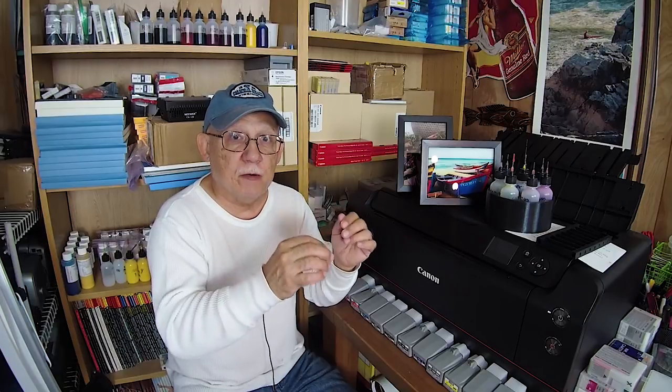It's beginning to make sense why you should actually print during that idle period. The concept of thinking you're going to save ink by not printing — because ink is so expensive — wanting to curtail print jobs and only use the printer once in a while to save ink: that's not going to work with this type of printer. Canon printers will not allow that to happen. They will run those cleaning cycles so that the printer remains free-flowing and clog-free.